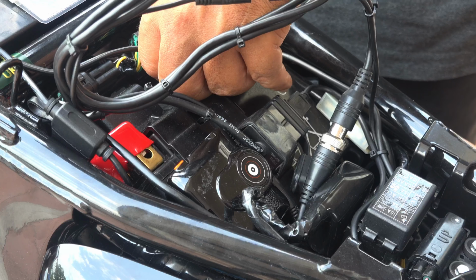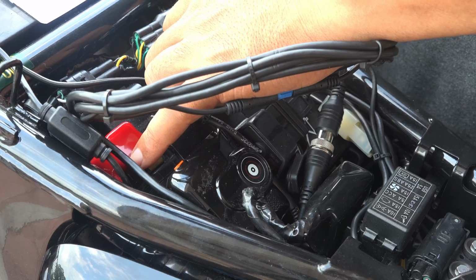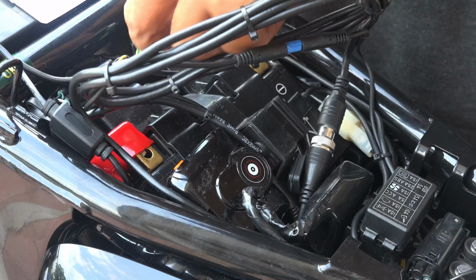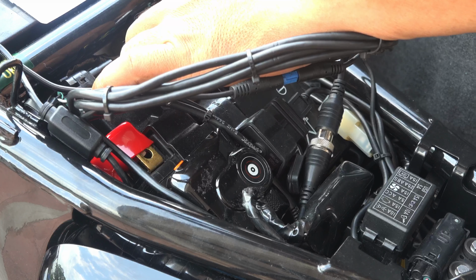Okay, I wish the screw terminal was smaller. So the negative terminal is in. Just tighten it up. This screw is quite soft, so you don't have to go overly tight anyway. Just make sure you have a good electrical contact. There's a torque value, but I don't have a torque wrench small enough, so I will not be able to do that. But no problem. Okay, the wire can be put back.